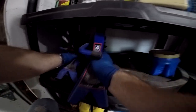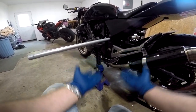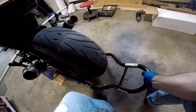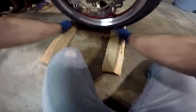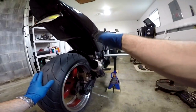Now get your jack stands out. My jack stands don't quite go tall enough, so I've got to get some blocks of wood to put underneath the jack stands to raise them up about an inch or so. I put some wood underneath the jack stands and they are right up against the pipe. So now we're ready to lower the sport bike lift. You should have enough lift that when you're done, your rear wheel will be about an inch and a half, maybe two inches off the ground. The weight of the gas tank, engine, and the whole front end keeps the front end down while you're working on the back. It's a good idea to put some wheel chocks on your front wheel. With the bike raised up by the frame, all of the weight is off the swing arm and the shock is completely decompressed.